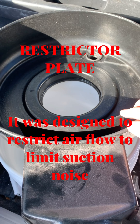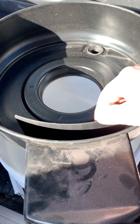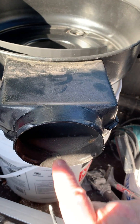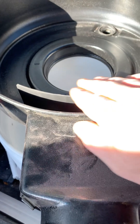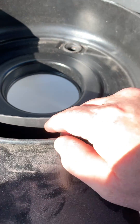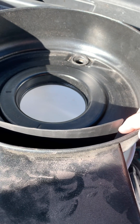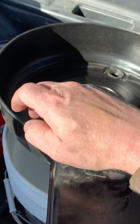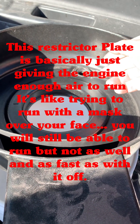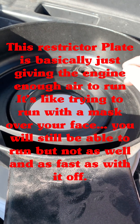The problem in doing so is that this restrictor plate covers up the whole entire inlet of where the air is coming in, and it is as high as the housing. So when air comes into your air cleaner, it's got no other way to go except hitting what basically looks like an air dam — this restrictor plate. Any residual air is forced to the right, forced to the left, and dissipates. What it's actually doing is starving the engine, because the engine is requiring so much CFM.